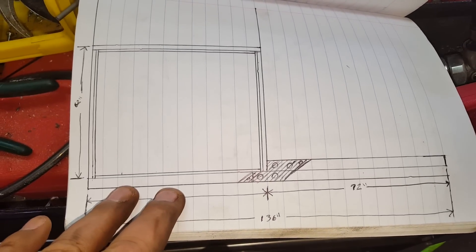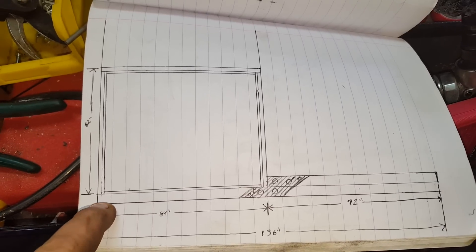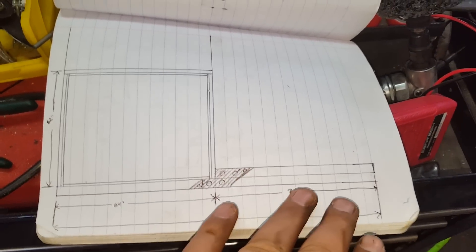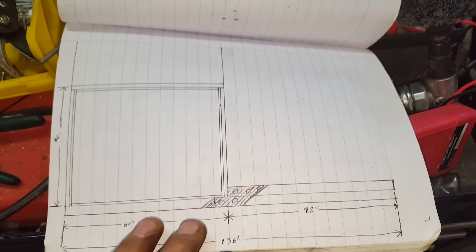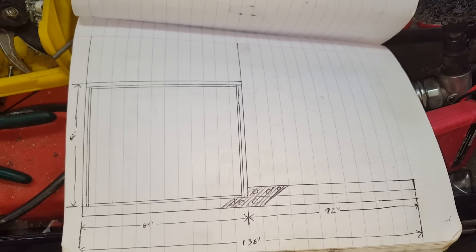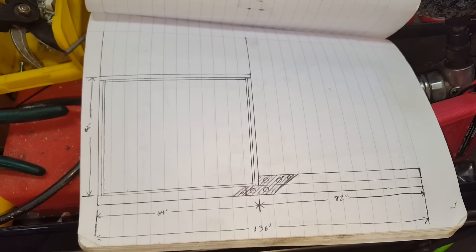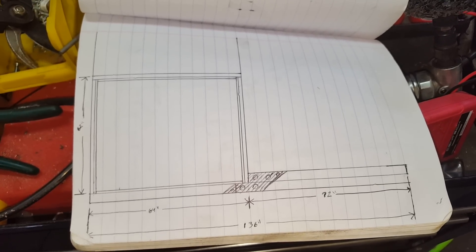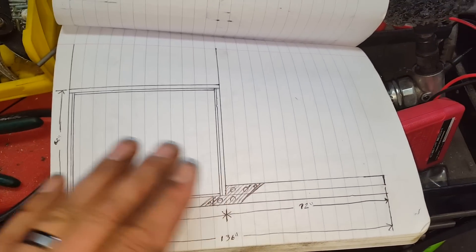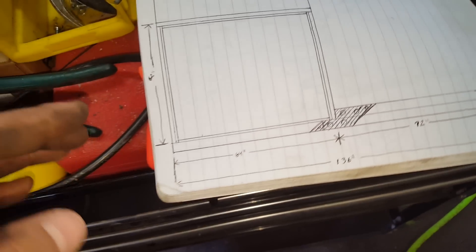This is basically what we're looking to do. We have that rectangle tube and I need to build two frame rails that are the main structure for all of this. I originally planned on making the sleeper cab one unit and the short flatbed another unit so that it has a pivot point like a pickup truck does, but then I changed my mind. The main reason was simplicity, saving material, and cleanliness. I like the idea of having the whole sleeper and bed look like one continuous piece of sheet metal — no visible seams when it's finished.